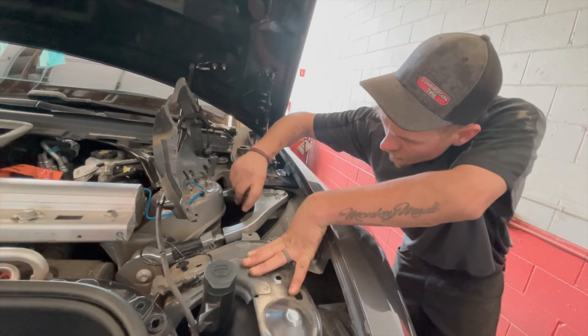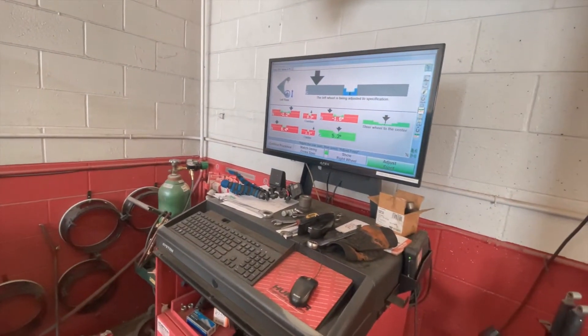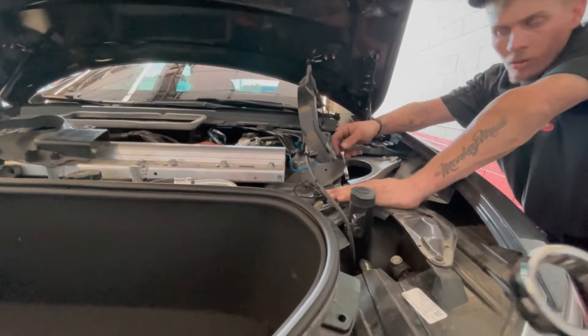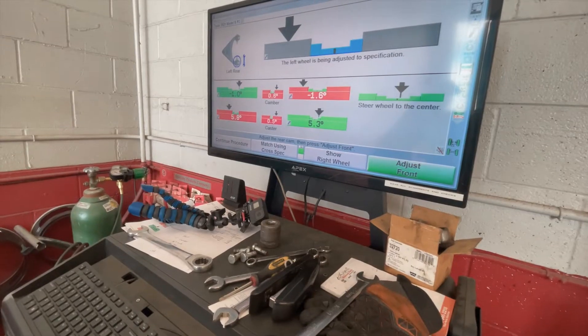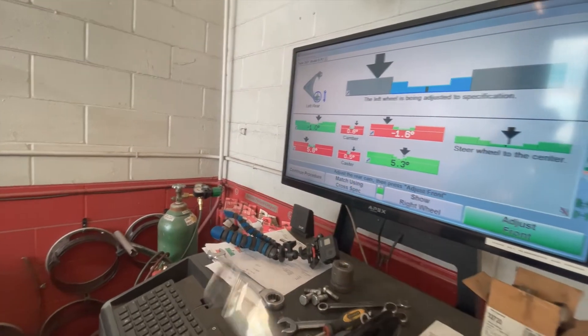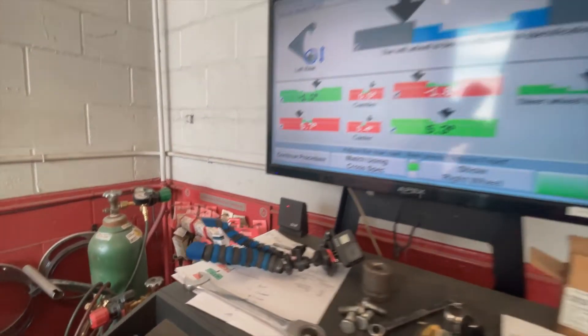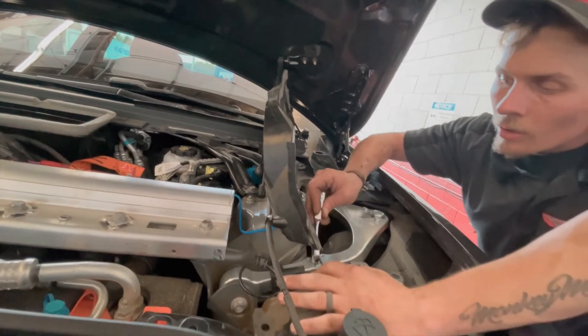Mostly from what I've seen it's usually caster primarily. I looked it up again — the back one is camber, the front one is caster. So what you're doing now is caster. Is it moving? Bottom left graph — should be going down. The goal for that is 4.7. I don't know if that's going to work because it's already all the way tight.